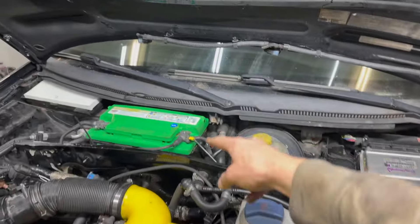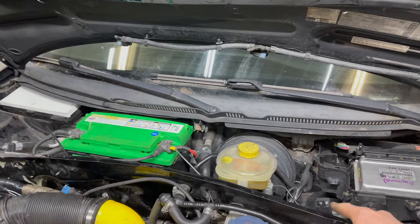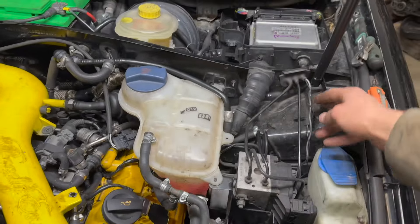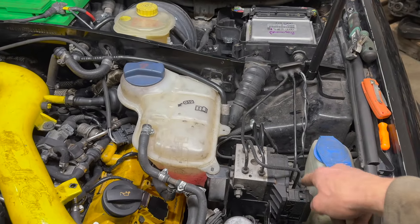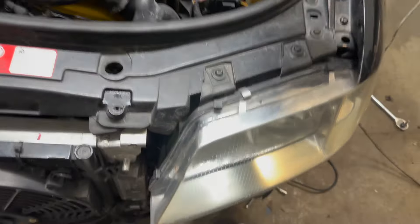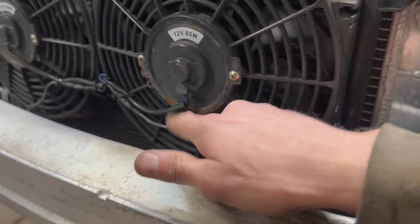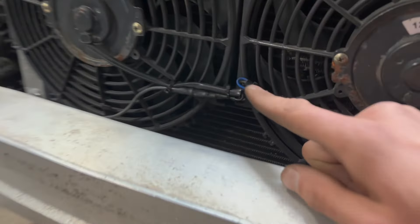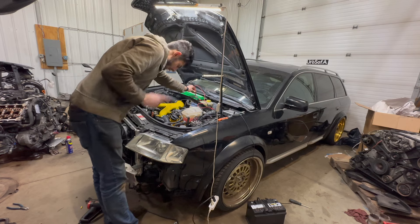The wiring is now finished. We've connected to the battery — battery goes to the relay, which is currently unbolted for testing. From the relay we have the positive and signal wire going down; the signal wire connects to our tap, the positive cable goes down to the fans connecting both fans, and then the negative from the fans goes down to the ground back there.